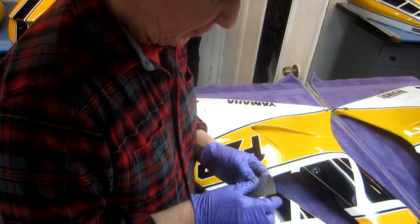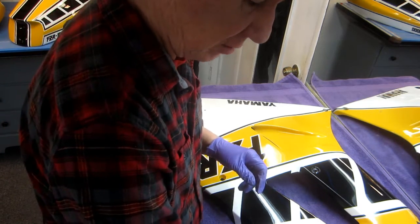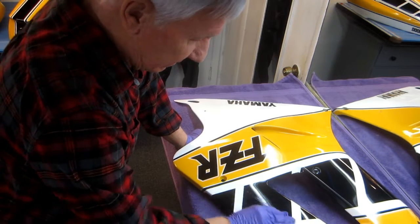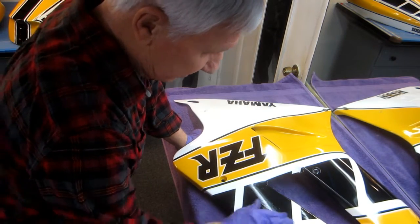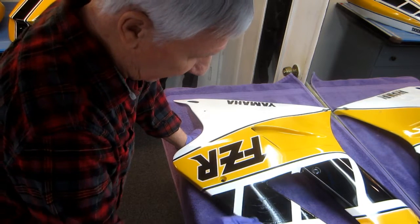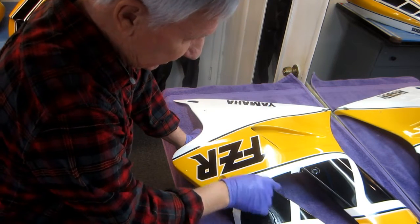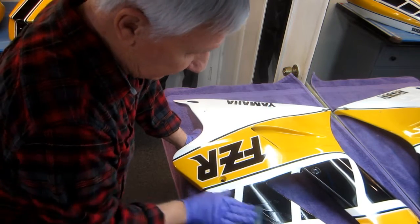The 2500 grit paper, and this is why I try not to rush this, because this does take longer. We used to use 2000 grit, but this adds maybe an hour to the sanding, but then you save 3 hours on the buffing. So I think overall it's worth it. And again, I try to segment the part out into pieces, maybe about as big as your hand. In this case, I want to get all of these edges of the paint. I don't want to feel any of them.